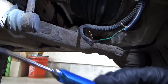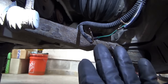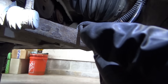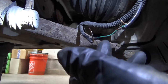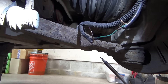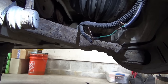Both wires snapped right off. Let's fix this up with solder and heat shrink, and wrap this up so the flex isn't as tight. I'm using a TS100 soldering iron with heat shrink. We're soldering these two wires together, then we need to structurally reinforce them because they're going to keep bending — it's a terrible design and can't possibly last long-term, but it solves the customer complaint. The break in the hard insulation appears to be factory, not a previous repair. There's no way to give it more flex room with the axle right there.